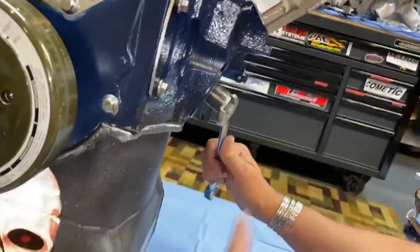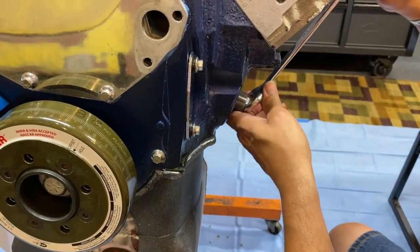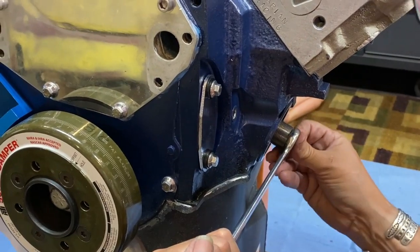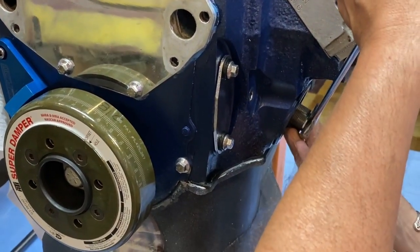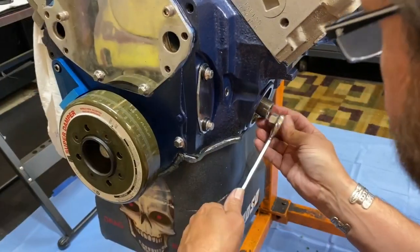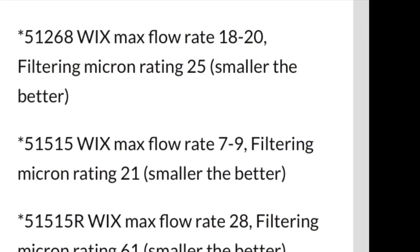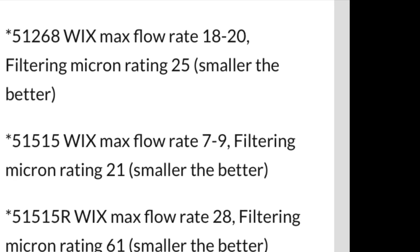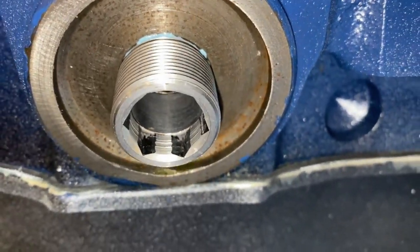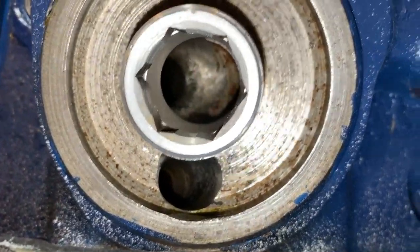I'll put a half-inch nut in here with that three-quarter inch wrench and just tighten it up — nice and easy, you don't want to smash your fingers. That should be good; I don't want to over-tighten and crack anything. Here are the specs on the 1268 and the two 515s — one is the standard and one is the race filter. More specs are at the end of this video. Here it is installed. I put just a very little bit of blue Loctite on there, just at the outer aspects. You can see there's a nice transition — looks like a win-win situation to me.